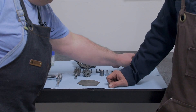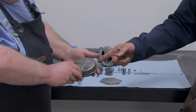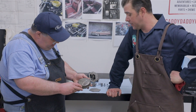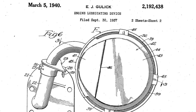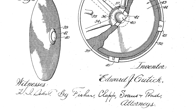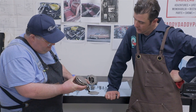Something I wanted to really address was the floating strainer. That's really interesting with what they developed and even the patent that they had on that. We'll be looking at a patent drawing here that's related to this — it would be the second patent number on it. This floats on top of the oil, and the idea is that it doesn't pick up any water or sludge that's gone to the bottom of the oil pan. But part of its job is to act as a filter.